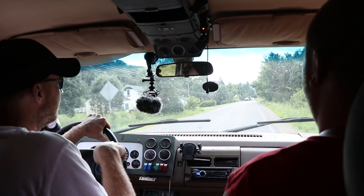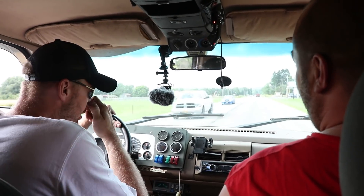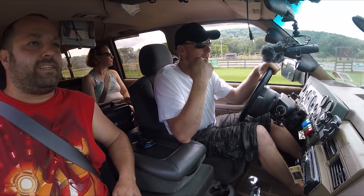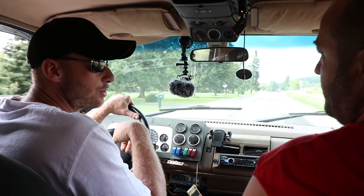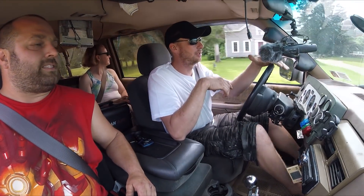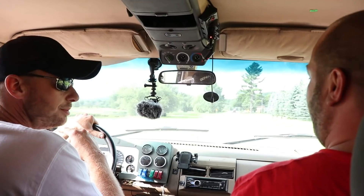Still running the Dodge transmission — the 47RH. The speedometer, is it accurate even with the 4.11s? Yeah. You got bigger tires — 285s — so it's slightly bigger than stock; it should have 245s, so that might make up the difference since it should be 3.73s but it's 4.10s in this. The Cummins in mine with the 4L80 wasn't a good match with the 4.11s — I was revving it out, so I went with 3.73s. Before I fixed the AFC housing, I had a hard time going past 65, but ever since I messed with that it doesn't stop.